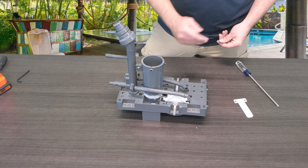This simple piece of plastic will help maintain the functionality of this turbine — it is the driving force for the cleaner. As the water comes through, it pushes against the turbine which spins it very rapidly, and that obviously drives the two front wheels of the cleaner.